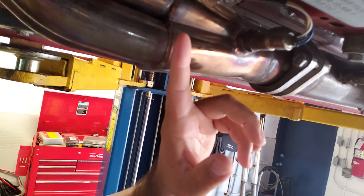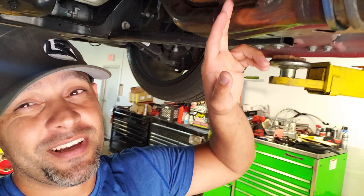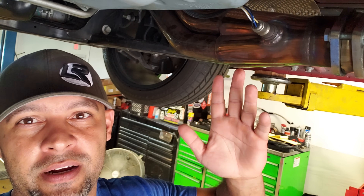A lot of people ask me questions about O2 sensors and E85, and it's really crucial — especially with long tube headers — to make sure that you cock it at a 45 degree angle or put a heat sink in it, bringing it away from the collector, and it should be good.